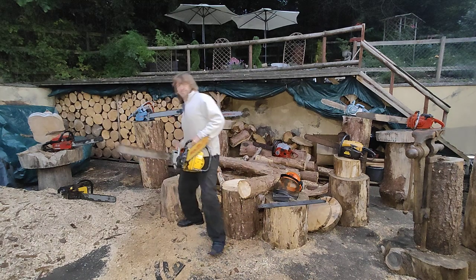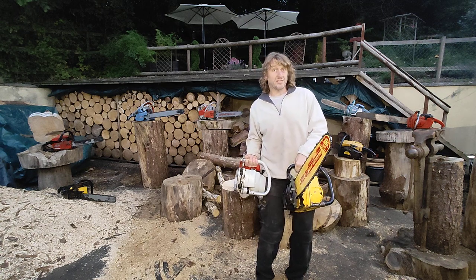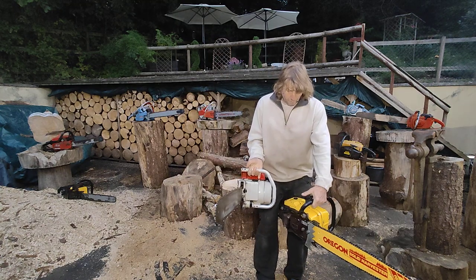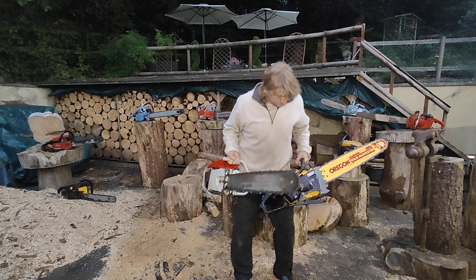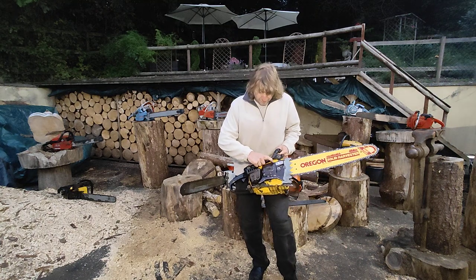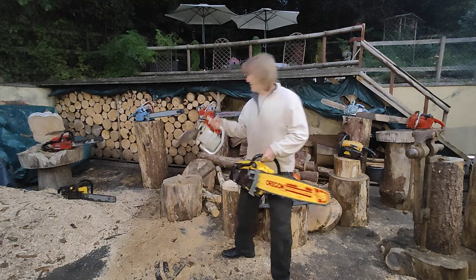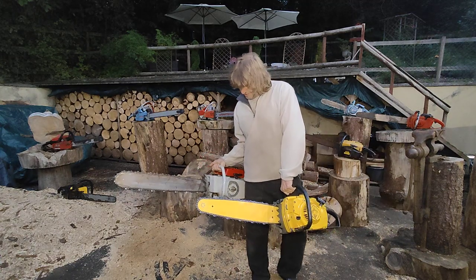So let me grab this drill. So this is Stihl's late 60s saw, then taken into the 70s with the 051. Double felling spikes at the front, AV mounted on the front handle, top fill for the fuel, top fill for the oil, albeit lower down on this one. She has, just like the 075, the 076, the 050, the 051, the adjustable oil control just above the clutch cover, absolutely love that. AV mount on the rear handle, exhaust right side. Just a staggering number of similarities.